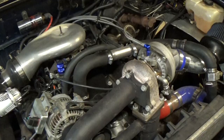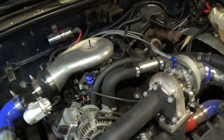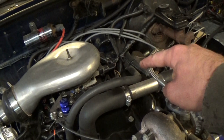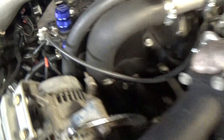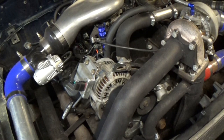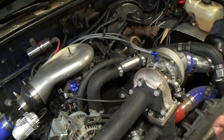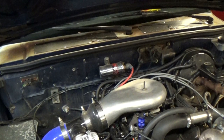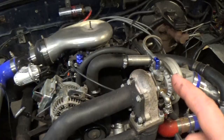For the coolant lines to the turbo, they run from the heater core outlet — through the heater core as factory — and then one heater hose runs underneath and into the turbo through an elbow, then out of the turbo through a 90-degree fitting and straight down to the heater core recirculation port on the water pump. This has worked very well. The only downside is the turbo restricts the flow of antifreeze through the heater core, making the heater much less effective, so don't plan on driving in very cold weather.